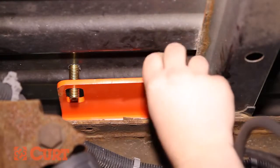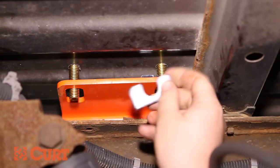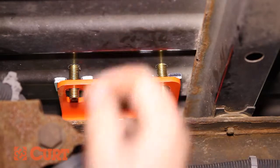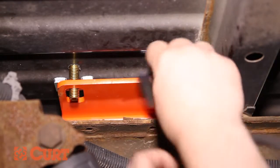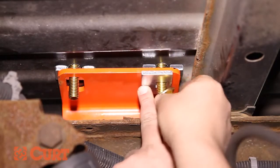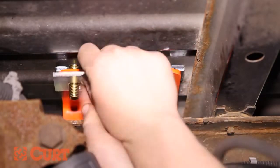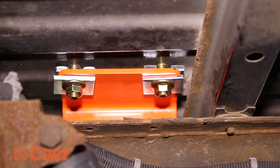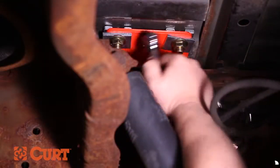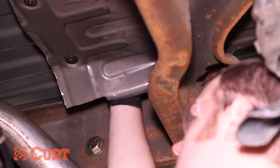Before attaching the mounting rails, install the U-shaped spacers between the box and the side plate at the 9/16 inch attachment points. They must be positioned in the raised sections of the corrugated rib of the box to ensure metal-to-metal contact. Fasten the rail to the mounting bracket using the supplied spacers and hex flange nuts. On the passenger side, you may need to bend the remaining heat shield to access the bolts.